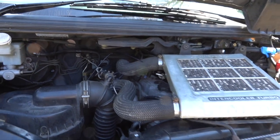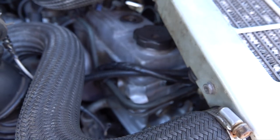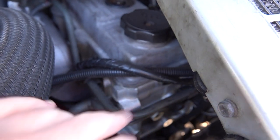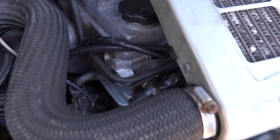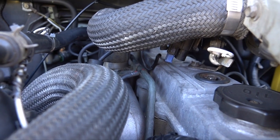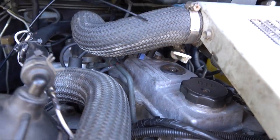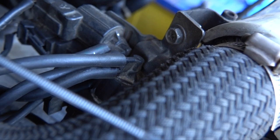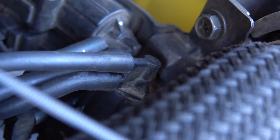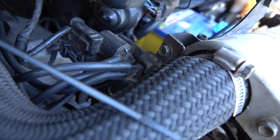Let's talk about vacuum lines. There are a few different places to pull vacuum from, but what I've learned is that looking at the bottom or front left side of the engine there's a big metal pipe — this is a good source of vacuum. That pipe comes all the way around the side and there are a few different places you can pull vacuum from. Make sure you're getting the right side of the vacuum because these pipes go into different little actuator valves — the top part of the valve is the in and the bottom is the out. If you tap from there, make sure you pull from the right side or the actuator changing state could make your vacuum disappear.